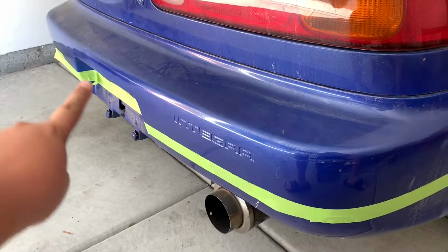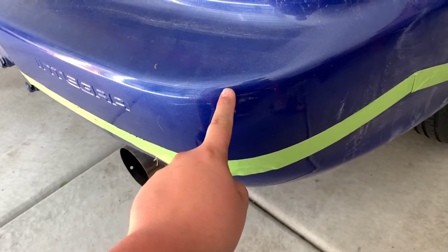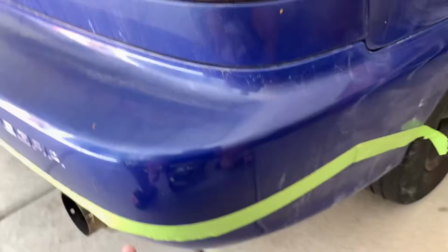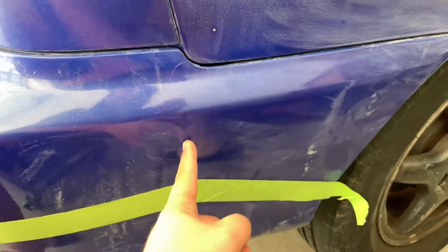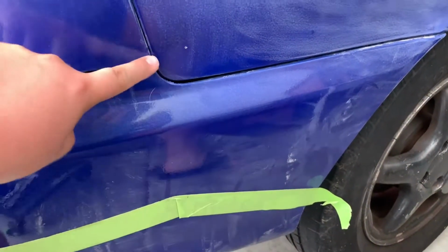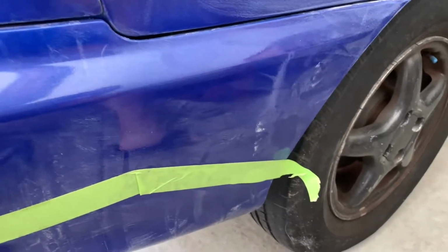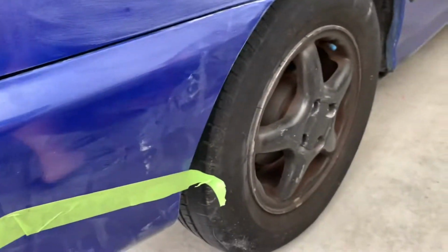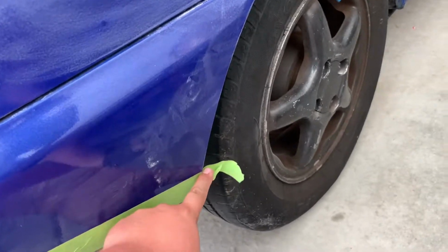All right, now that I've got everything lined up, I'm going to show you the points of reference that I did for my bumper, and then we'll get cutting. Most of this front part is 4.5 inches from the beginning of that top bend. Then I stopped measuring 4.5 from about here where this corner is, and went over to here. I followed where the garnish goes and put a tape measure down on it straight. From where the garnish is to there, it's about 6.25 to 6.5 inches, depending on how well I eyeballed it. How I got that line was I measured from this corner to there, and that was 10.5 inches.